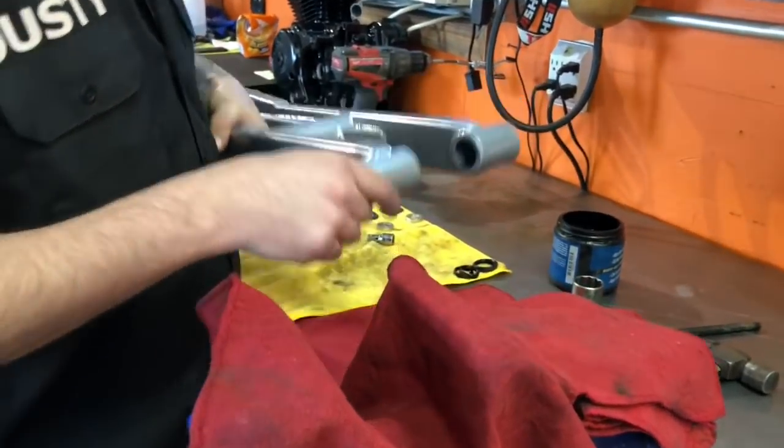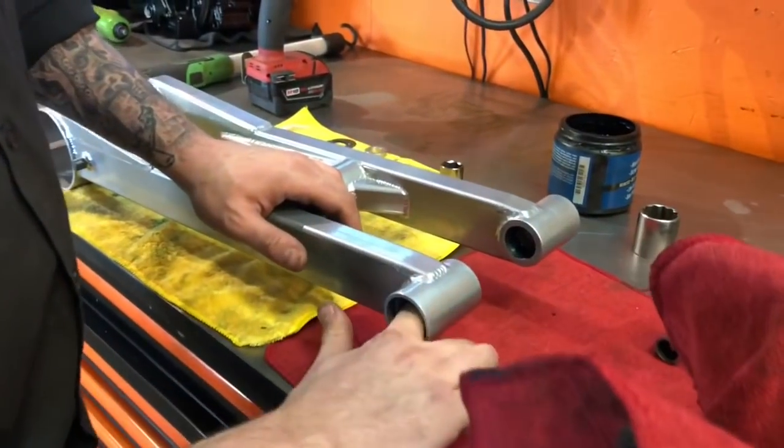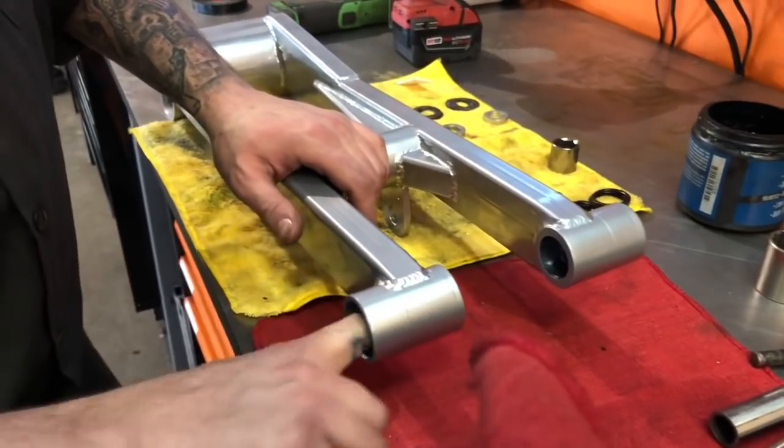You're going to want to just press your inside bearings in just enough to give you enough room for your seal to slide in there and have enough room to fit. You can put it in a little farther or leave it a little bit closer, but as long as you can get your seal in there, that's all that really matters. The next step is to put some grease in there — I always recommend using a good waterproof grease, really get it in there nice and coated and deep.